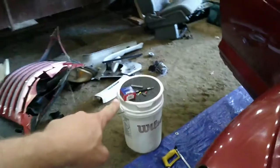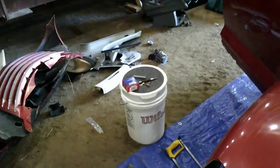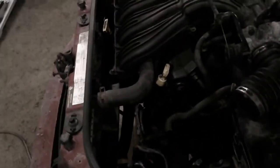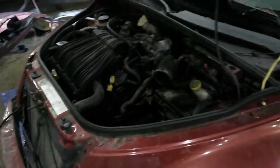Right in there I have the thermostat that I gutted from my PT Cruiser last year — it worked great. I also have the other cooling sensor that I'll unplug and strap on top. Otherwise just going to pull some wiring. Right there is the starter — it's so exposed that if I get any press up front, that fan will go into the starter. That's actually what took me out of my first derby with the cruiser. I'm going to take that fan off, unbolt it, unplug it, and spray foam the electronics around it to give more space between the fan and starter.